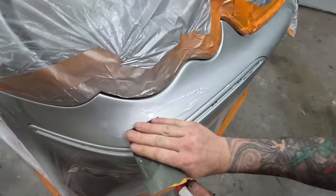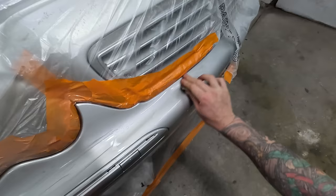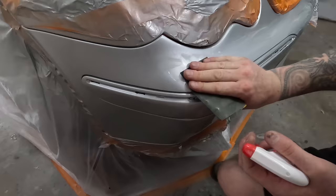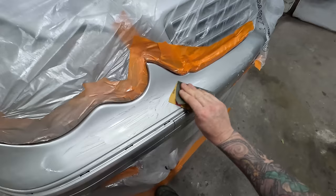Had a few big chunks land in it. And this blend, it's a bit gritty on that blend. Probably part of that is the overspray from the colour. That's looking pretty good. So that's just a quick scuff with 2000 grit. We'll clean that out, use that again. And then I've got some 3000 grit here, just a used bit. That'll be all right.